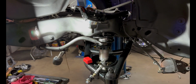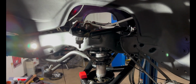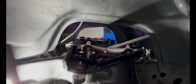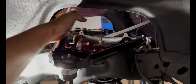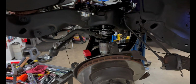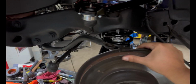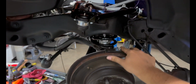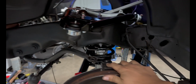Alrighty, everyone, just to show you, these cars don't all go together super easy. This is the first little snag we're running into. We've flipped these upper control arms a couple times and also flipped the cams, which you can't really see, but they're in the arm itself here, and they'll center it about half an inch forward or back. As an example, we've got this mocked up here, so that's where it wants to be, right there, and you can see it's in the middle, and it is just not even close for these meeting up.